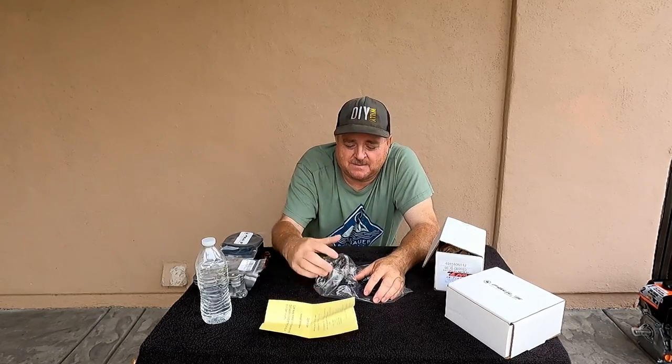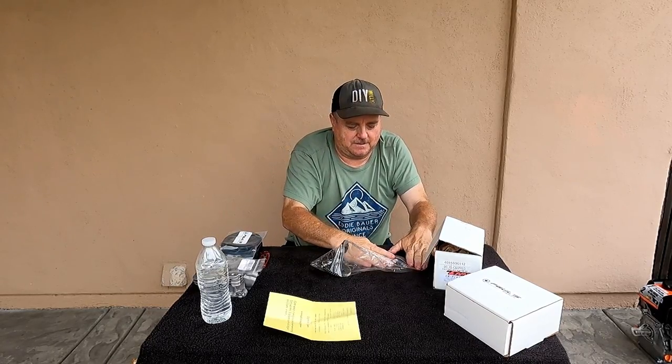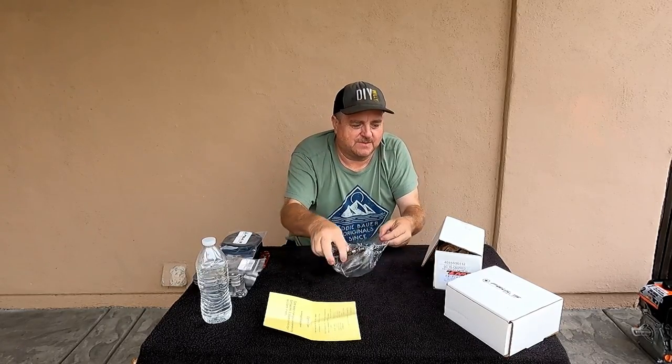It's gonna make the engine run a little harder, a little rougher lope, you know, like the old days. And that bigger carburetor is really gonna make use of that longer duration of those valves being open. Maybe I'm wrong. If I'm wrong, please somebody put in a comment before I build it. Maybe I'll use this one instead of the 308, but I think the 308 will be a better choice. Anyway.